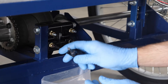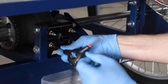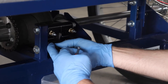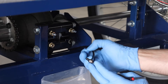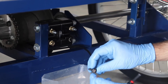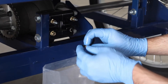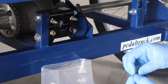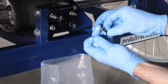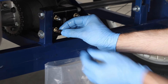The line uses a banjo bolt — this is a 4mm Allen. When reinstalling, you will want to replace these copper washers on either side of the banjo fitting. One will go between the bolt and the fitting, and it gets a copper washer on that side that screws in. So once you have a new caliper in place, you can get your new copper washers that will give a nice seal. Put one on the banjo bolt, slide that through the banjo fitting, make sure there's a copper washer on the other side, and it will seat against the fitting on the caliper.